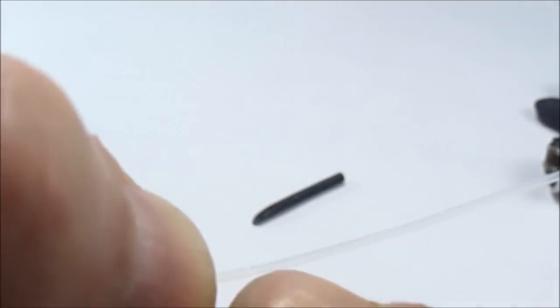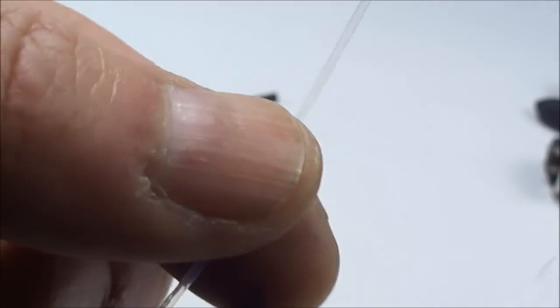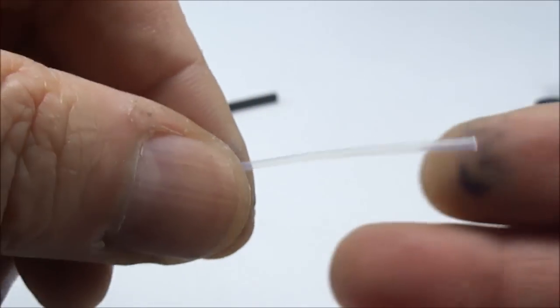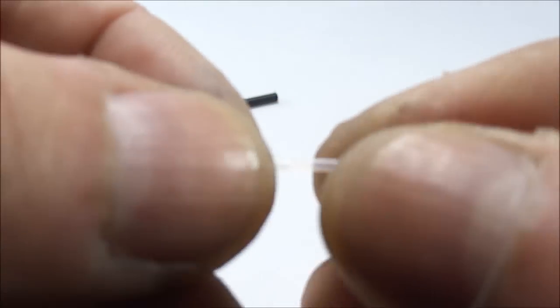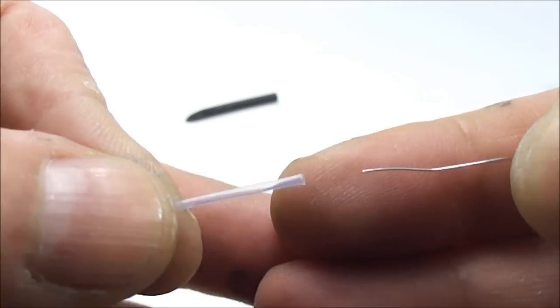What we've actually done with this replacement breather tube is made a small hole in it, so this one's ready to fit. Incidentally, this is some kind of plastic — I believe it's a teflon-coated plastic. As I say, they come in lengths; I think I bought this in maybe a meter length or something like that, and what you generally do is just cut them down to size to fit the 51. Now because it's a plastic and it's not as sturdy as the original breather tubes, what I like to do is just thread my guitar wire through it.